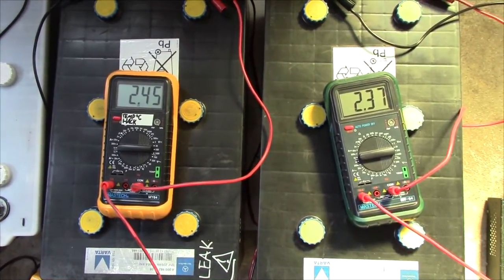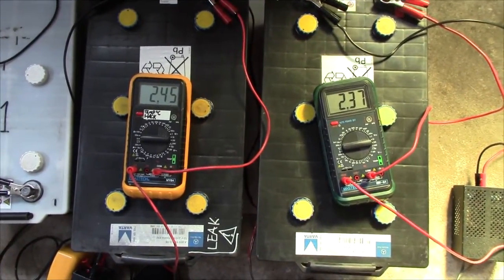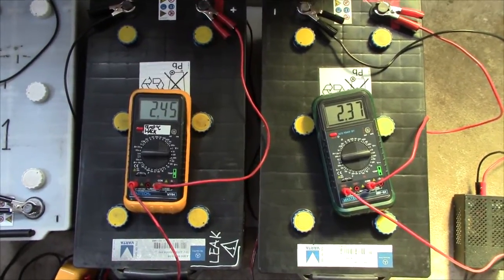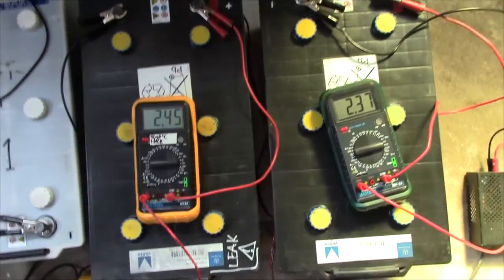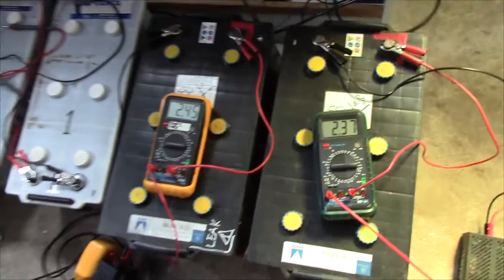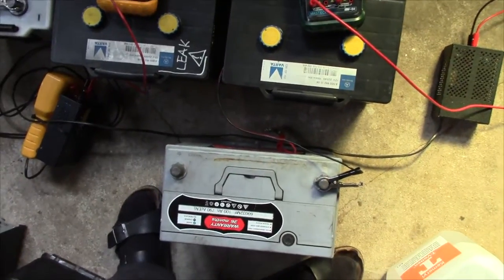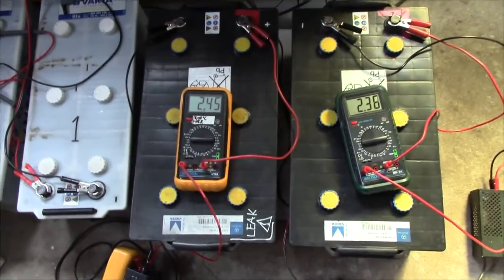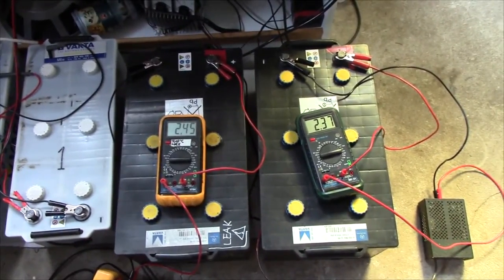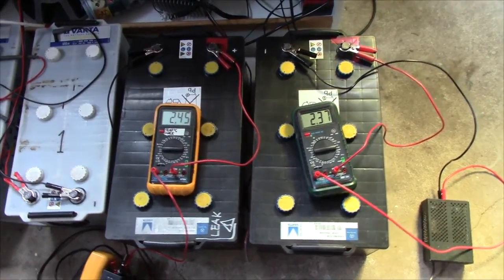I guess I could probably take them off the charger, as they've been charging for, well, maybe 20 hours in total, and cycle them when I give this one a cycle, since it's going to take a lot less time probably. Then I'll just charge them up again and see if they draw less current when fully charged and if they get more capacity out of it.